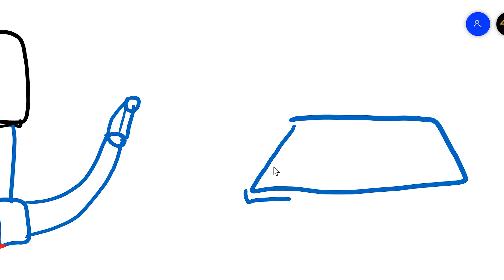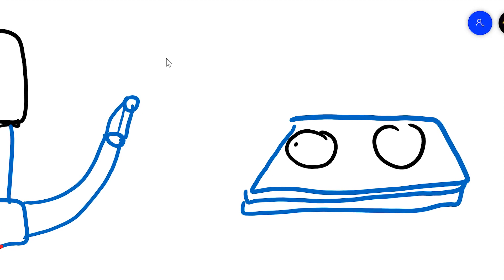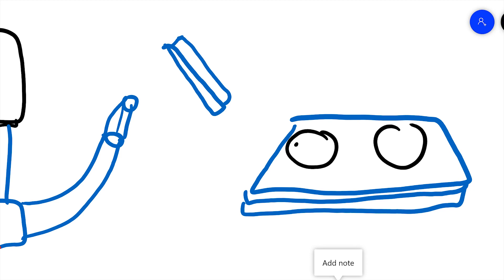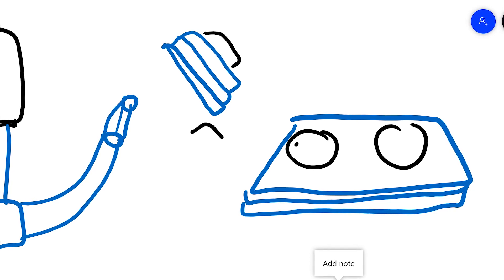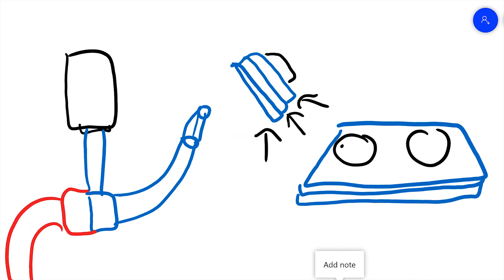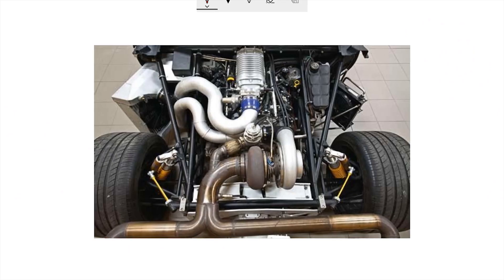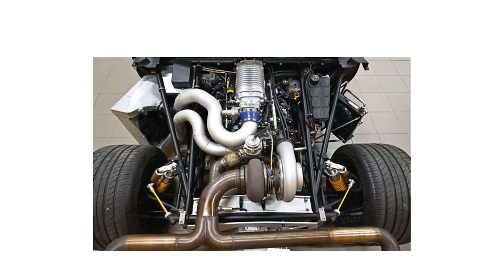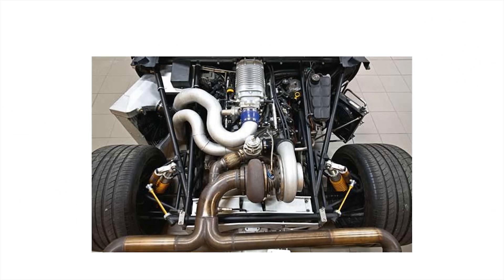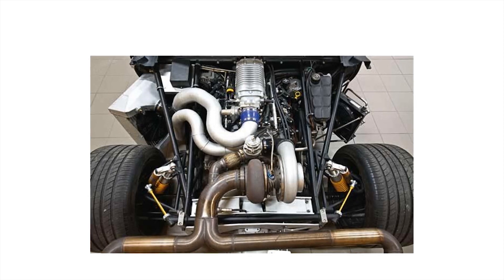At the front of the car you can double stack: you have the radiator and the heat exchanger for the intercooler. The fan is in the back, so the first could be the heat exchanger, second the AC condenser, and the third the radiator — you can duct it however you want. However, the Zenvo design is less complicated because you don't need a water tank, which adds weight, or a water pump, which could reduce reliability. Also, an air-to-water intercooler underneath the supercharger increases height and raises the center of gravity, so they likely wanted to reduce that.